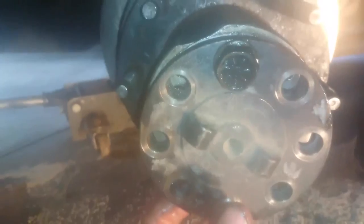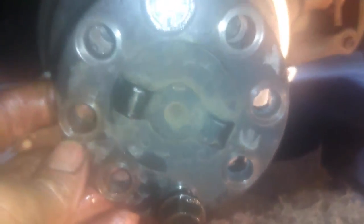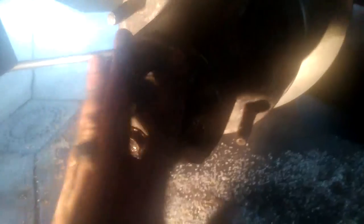Now it's in. Line up that little flange, take one of your bolts and get it lined up through the flange. Do the top one and then the bottom one to center it out. Make sure you're not ripping the gasket and that everything is going into the holes nice and straight — don't cross-thread it. Go ahead and start putting all your other bolts in, then we'll tighten them all up.